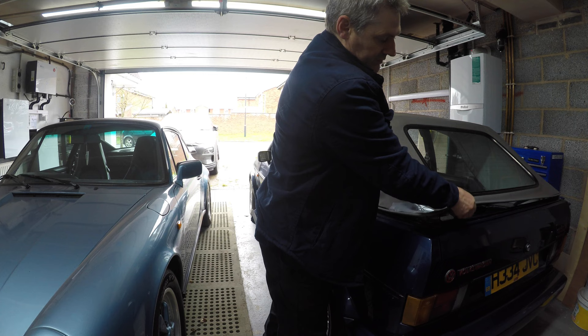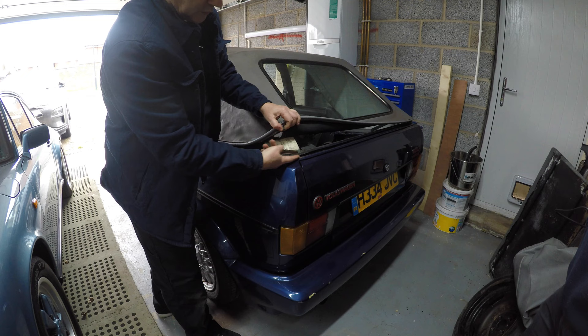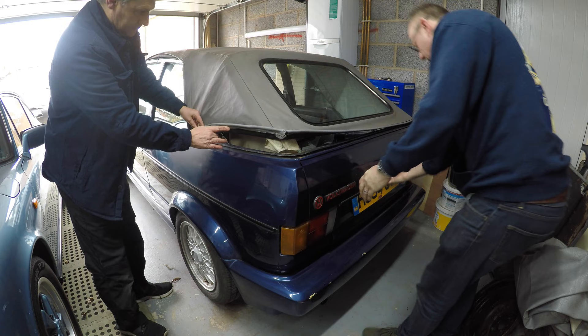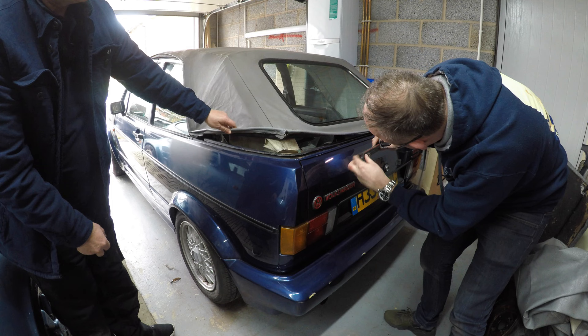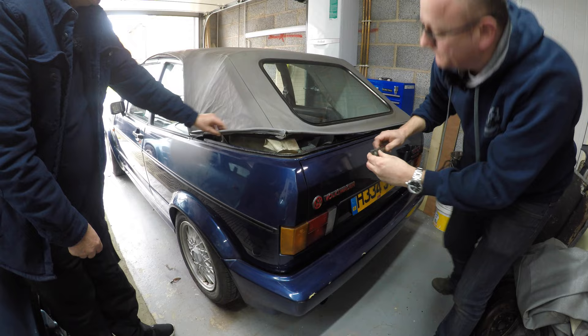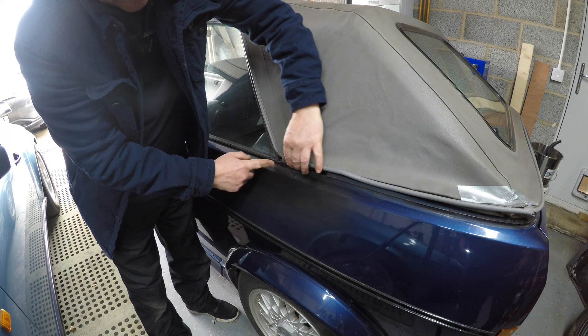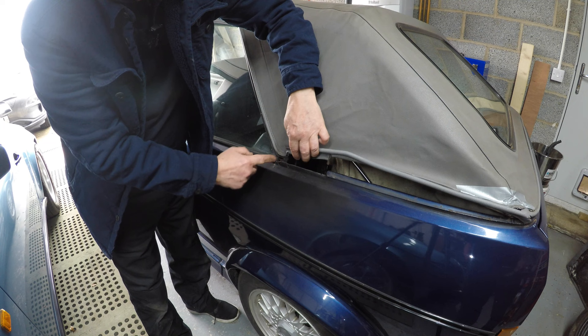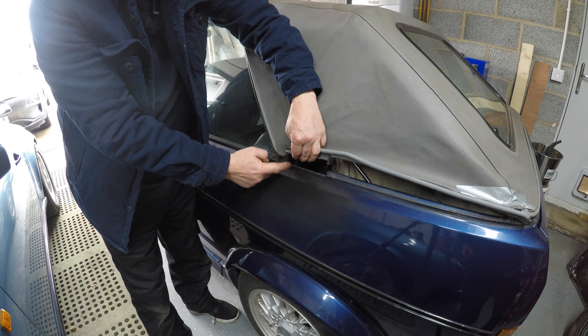Turning to the rear cable channel - there's a cable that goes between the material here which is then driven into the channel. There's a small piece of rust in there but once the car is cleaned up and painted I don't envisage that being an issue. Let's grab a torch and actually have a look to see how bad the rust is. Okay, that doesn't look too bad - there's a bit of bubbling going on, but I guess we can make that the body shop's problem. Another issue is the hood - we can see the remnants of the hole here. The hoods are pinned to the body of the car behind this piece of steel; there's a metal tab and there's a screw that goes through here with the half moon trim. What happens is if the tab rots away and falls off - which they invariably do - the screw will rock up and down as the hood goes up and down and will eventually rip a hole into the body.